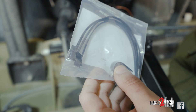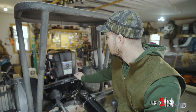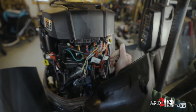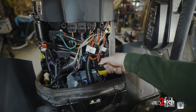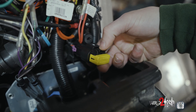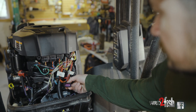For today's installation we're going to use the zip ties to keep the plug-in out of harm's way. The 10-pin plug might be in a different location on your engine — it could be on the side — but on this 90 horsepower four-stroke it's in the front. To give ourselves a little more room we're gonna pull off this friction-fit shroud. Here's that plug — it says Terminator on the bottom of the yellow cap. This is just a cap, so we have to pull it off by pressing down on this little black mechanism and it slides right off, revealing the pins on the plug-in.